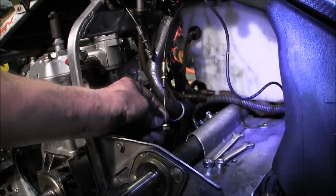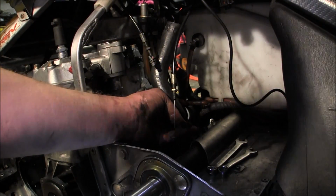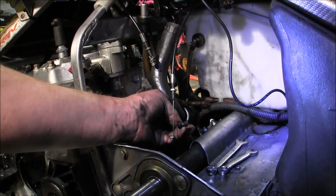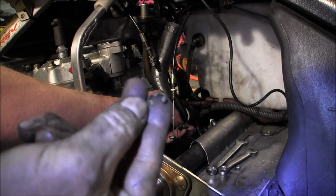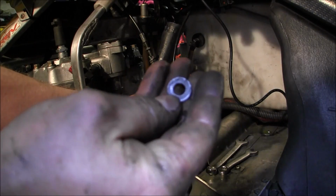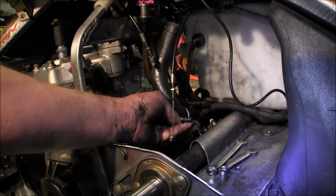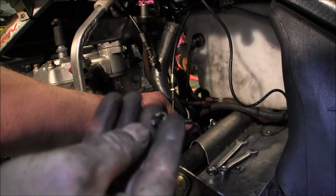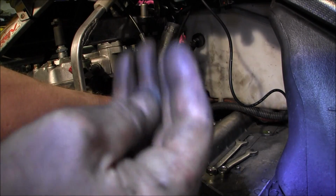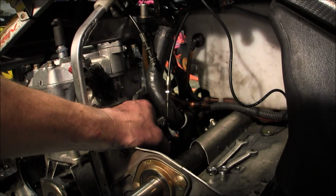This oil injector line is really stupid. You gotta get, let me get the clip. On the one side, there's a clip. And then behind that clip, you have a little washer. Then you have to tweak that all the way around and get the line out the side underneath the thing without losing that clip. Take that off first, then the washer, and then you gotta wrap that thing down and get the line through. Yeah, it's a pain in the ass.